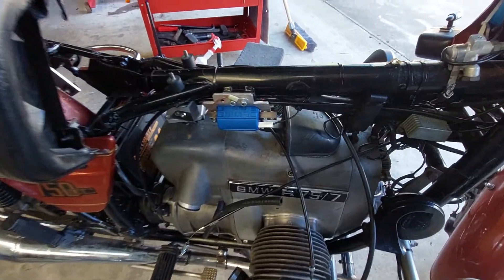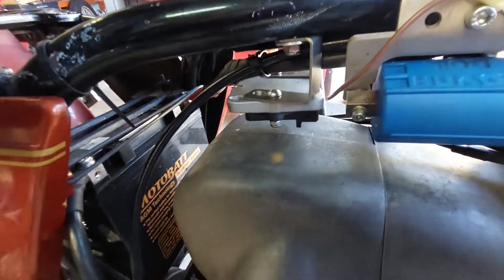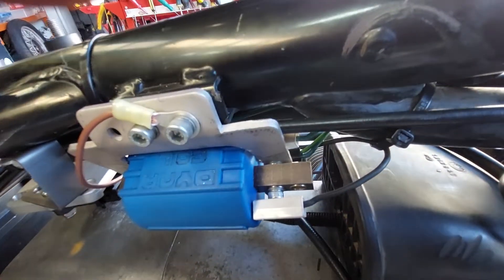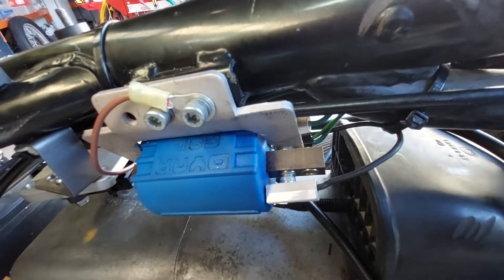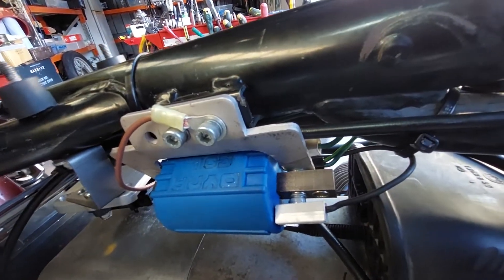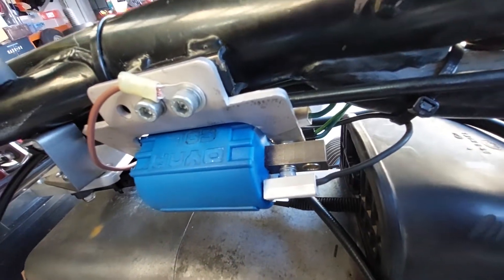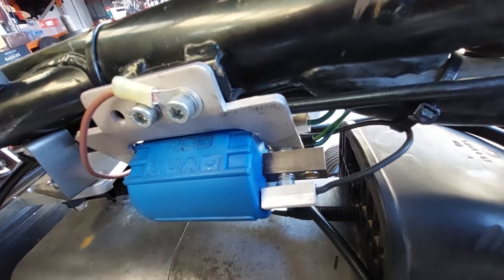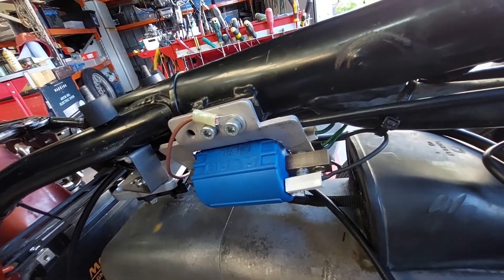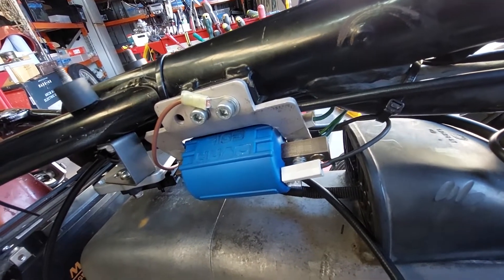I've just gone around the other side of the bike now. You can see there the module brackets with the module hanging down on the side of the coil. As I explained earlier in the video, this is the way I've set it up so that the coil is actually swept back in under the frame, which protects it to some extent from moisture — though of course it's a motorbike so it's not going to save it completely. You can see that the earth wire is clearly and strongly mounted. I put that earth wire around onto that brand new bracket, ran taps down all the threads in the holes and the plates on the frame, so it's a very nice clean connection with a really good earth.